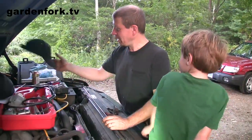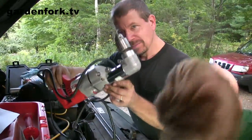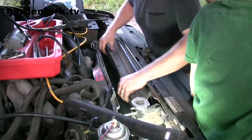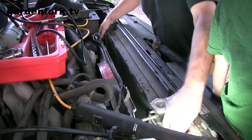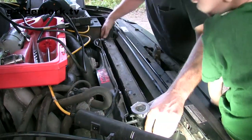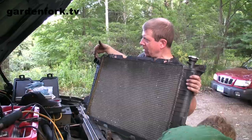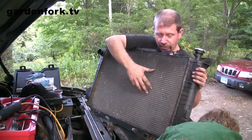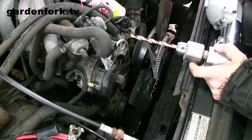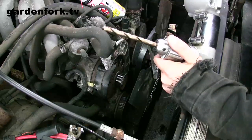We've had to do a couple of things. We went to the rental store and rented a right angle drill. We've disconnected the radiator hoses, loosened the cowling, and now we've got to take the radiator out. In case you're wondering what a radiator does — this cools your engine. The hot water from your engine comes in, goes through these coils, a fan blows on them, and cool water goes out the bottom. The idea is to use the right angle drill with a brand new drill bit to drill out the bolt.